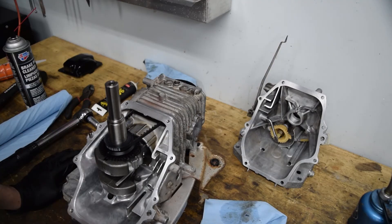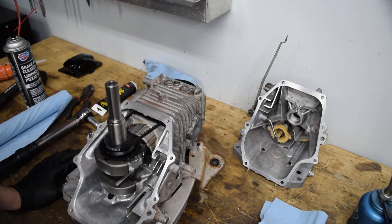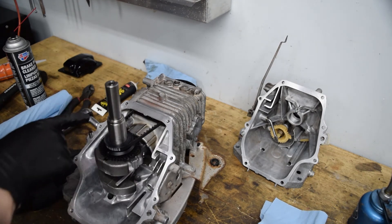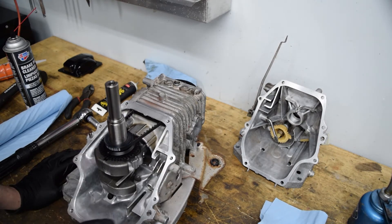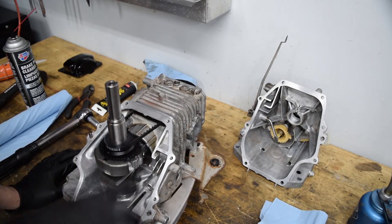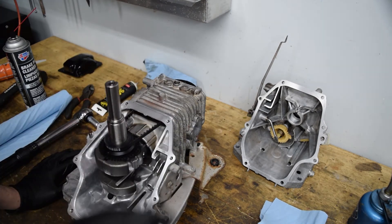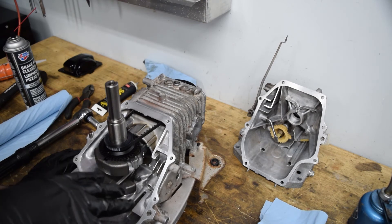I've spun it over about half a dozen times and it still lines up timing-wise — perfect. I've already wiped the mating surface with brake cleaner just to make sure the RTV adheres. We're going to do a bead all the way around. Honda recommends that you finger it — just do a little dabbing method — to increase the surface area of the RTV. Then lay the other side of the case down, put the bolts in hand tight, let it sit for about 10 minutes, then torque it down fully. You don't want to torque it while it's wet because it'll just squeeze all the RTV out.